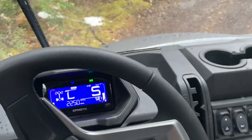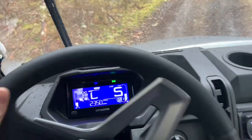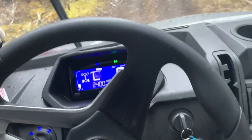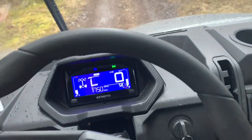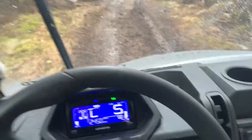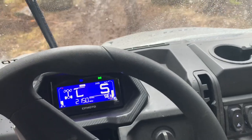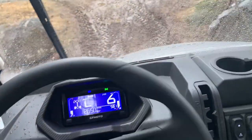The other setup would jump up in RPM when you slowed down and it kicked into a faster gear and revved right up. But this current setup gives me a beautifully smooth clutch - I'm driving along at about 23 km/h and it's engaging at just over 2000 RPM. Just liquid smooth - I love that.